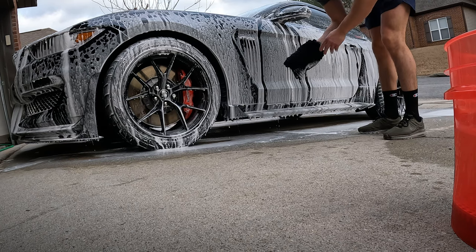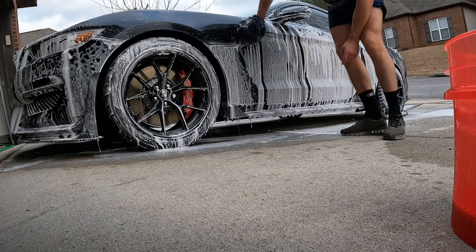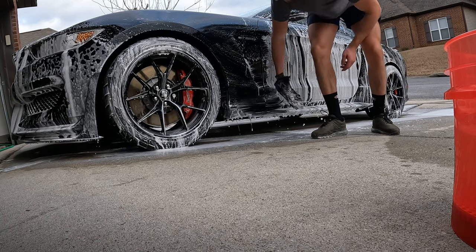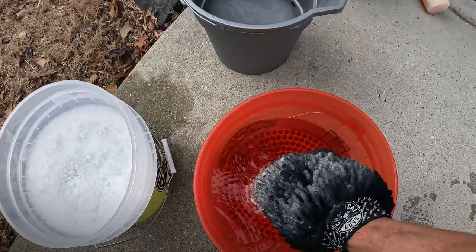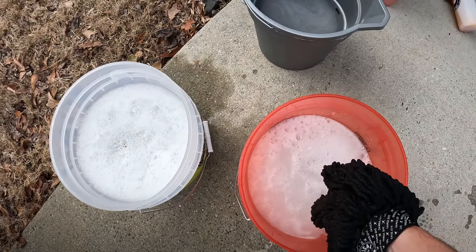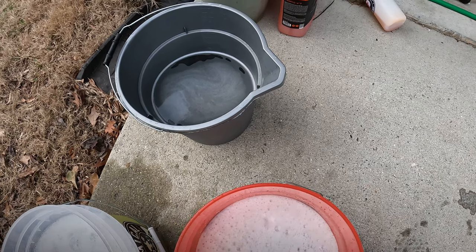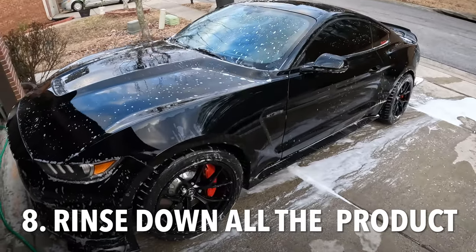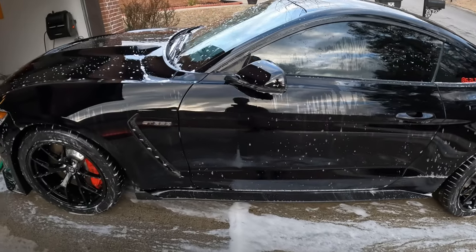You always want to go in clear strides so you just go over one panel at a time, not in circular motion — you don't want to get any scratches. Just wash it off like this. This is where the second bucket comes into play. You'll dump the mitt in the second bucket to get all that dirt off, then use the first one again with the clean water so you're not getting any scratches in. That's why we use two buckets. We're done with wiping the whole car down with the wash mitten and we can see it's already pretty clean. Now we just have to rinse all that product off and then get to drying the car.